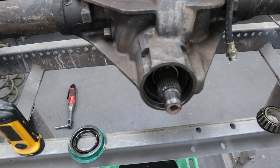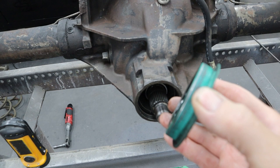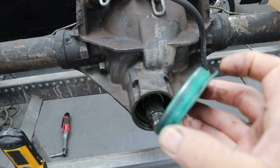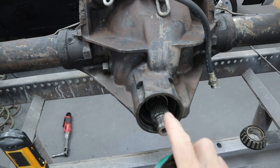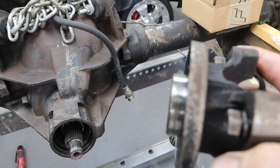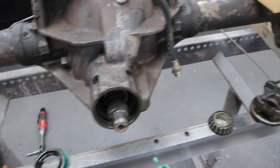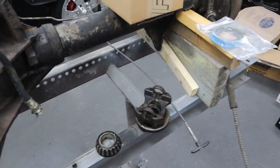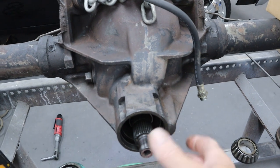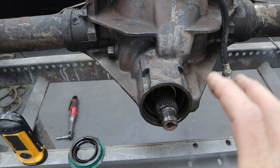Turns out, doing some investigating, they possibly used to make two different seals — a 12-bolt truck seal and a 12-bolt car rear-end seal. They don't make the car one anymore, and the truck one is deeper, so the inner lip ends up way too deep inside the rear end. It actually doesn't contact the sealing surface because the snout's not long enough. You end up with only a dust seal doing the job, and the dust seal will not stop gear oil from coming out. We've got a new seal, a new crush sleeve, and a new nut. My buddy Dave thinks we can go out on his lathe, make a spacer to space it out, put sealer on the new seal, and drive it home flat so it seats properly.